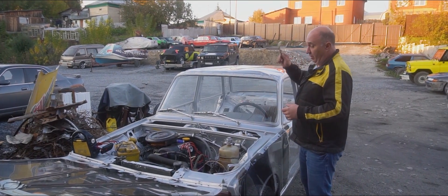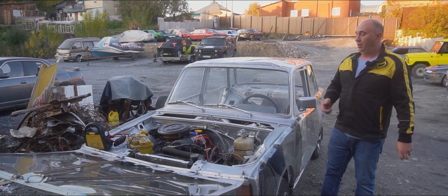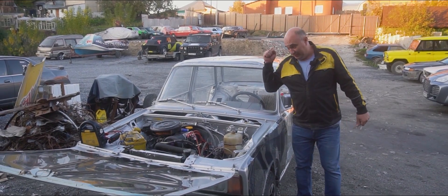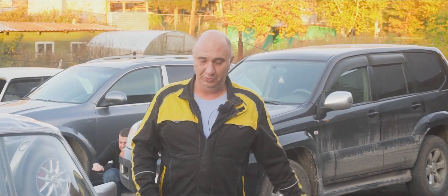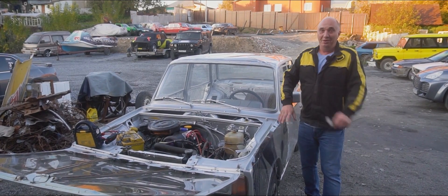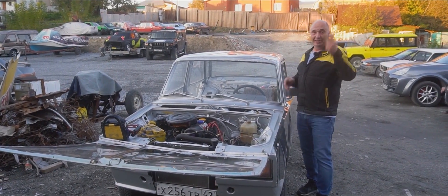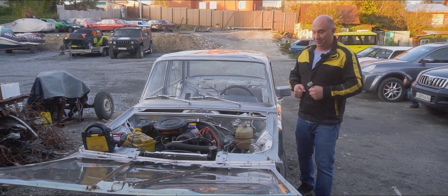So it's okay to give it that sort of a charge for a slight boost since we don't have a proper charger. We should note that this engine is lacking any sort of ECU, and we get a serious increase in voltage when the alternator is missing a voltage regulator — at the very least it endured 56 volts. We no longer had spark after that due to the switch getting burned, but there's really nothing else to burn in here. Go ahead and share some ideas on how to finish the car. This thing has lived through so much — mad props to the car for looking so good. Watch us, subscribe, send in your comments and suggestions, give us a big thumbs up. Catch you later.